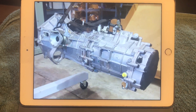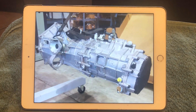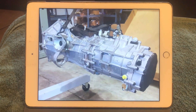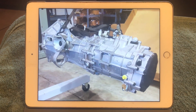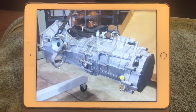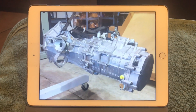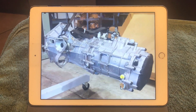Here is a picture of the Graziano transaxle — this is the same mid-engine transaxle that comes with an Audi R8 and also various models of Lamborghinis. This particular transmission can be sourced through Race Car Replicas (RCR), and they sell it as a brand new unit with a warranty. In my opinion, that is the best route to go. You can get a used Ferrari or Porsche transaxle, but it's nice to buy a new product you know is going to work without needing reconditioning.